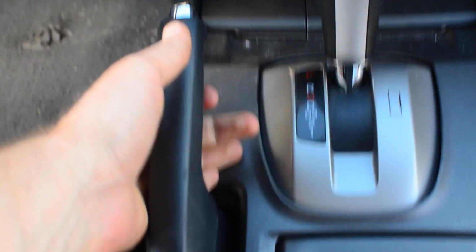With the console up, you can kind of see how we could loosen or tighten the brake as needed from the actual adjuster. But all we're doing is just tightening this until it becomes taut. It's too tight, I think. So now we've gotten it tight enough, and we're going to check it out in the front of the car. Now that that's done, we could lower this and try to raise it and see if we have any tension. Yep, it's a lot tenser than before.